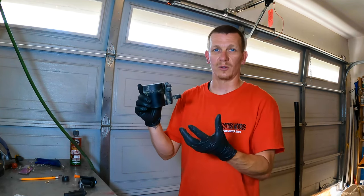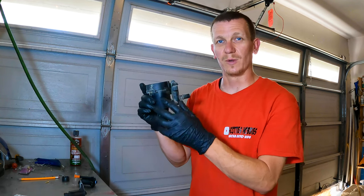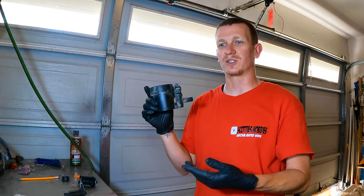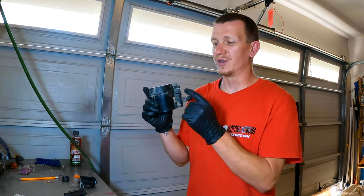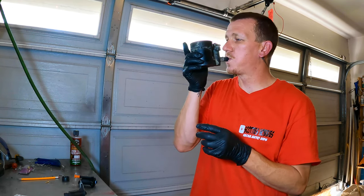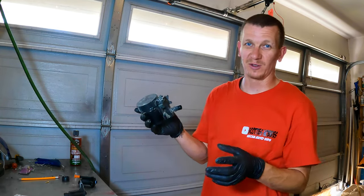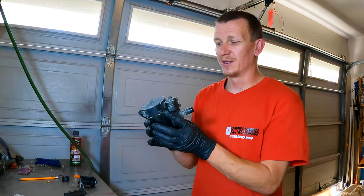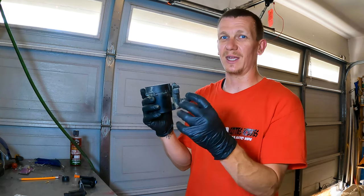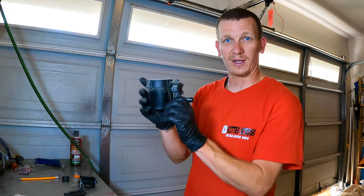When pumping gas there's no voltage applied, so this is open and vapors should get released. A couple of things could be wrong: dust, dirt, and stuff gets built up because fuel expands and contracts with temperature and humidity, so air needs to go both ways. It needs to be released when you're pumping gas and sucked in during expansion and contraction. This one had an intermittent issue — it gets dirty, gets clogged, the diaphragm and filter get blocked and don't allow flow.